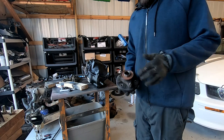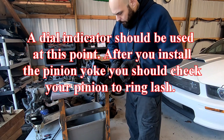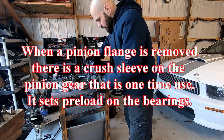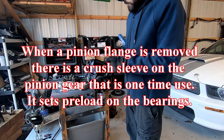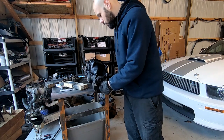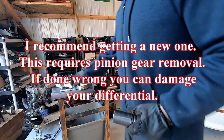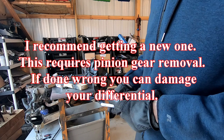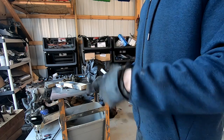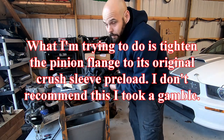What I'm doing now is installing this pinion. My friend Jack ended up counting the turns and marking the location of the nut for me — it ended up being 11 turns. I'm going to put this on and give it part of a turn just so it's on the threads. I marked this socket with a paint pen, and every time the socket comes to the top I know it's one full rotation. I'm going to use the impact gun and count rotations until I hit 11. First I'll do it by hand until it gets tight because it spun a little fast.